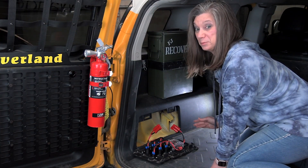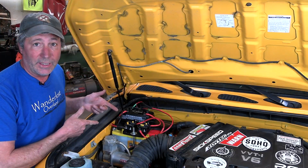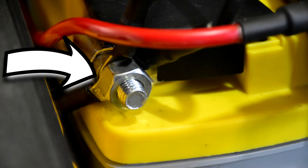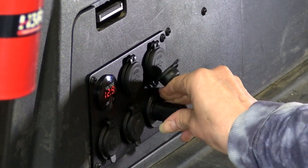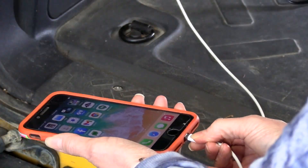The panel is very easy to put in place. At the battery we hooked our positive up to a breaker we have in place, making sure it's turned off first, and the negative went directly to the battery. By keeping it simple and using moderately priced components we were able to keep the cost down to around $160. That includes the circuit breaker at the battery, the outlet panel in the back, and everything in between.